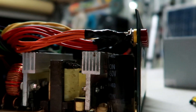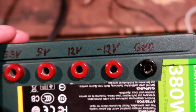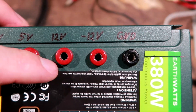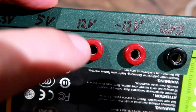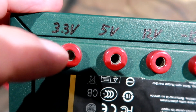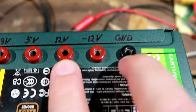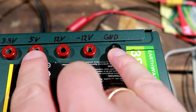Let me quickly put this together again. I kept mine really simple — I have only these four voltages and ground. This is basically all you get from these power supplies. Ground is all the black wires. Minus 12 volt is the blue cable. Plus 12 volt are the yellow ones. Plus 5 volts are the red ones. And 3.3 volts are the orange cables. If you connect something to the 12 volt and to the ground, you have 12 volts. Connect something to 5 volt and ground, you get 5 volts.